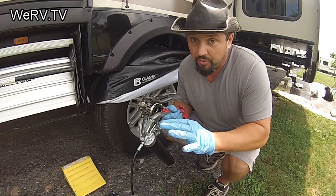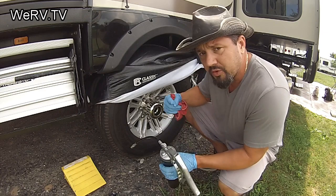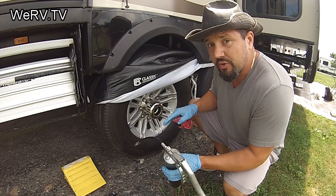Don't over-grease them, because if you put too much grease in there — there are seals on your bearings, a drum, and brakes in there — you can actually grease your brakes, and then you won't be able to stop. That's not a good thing.